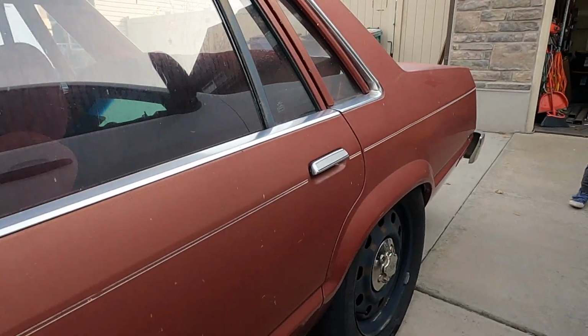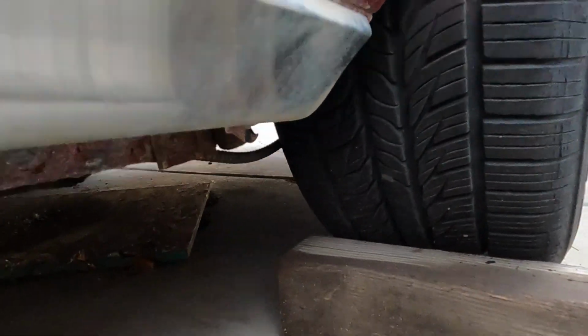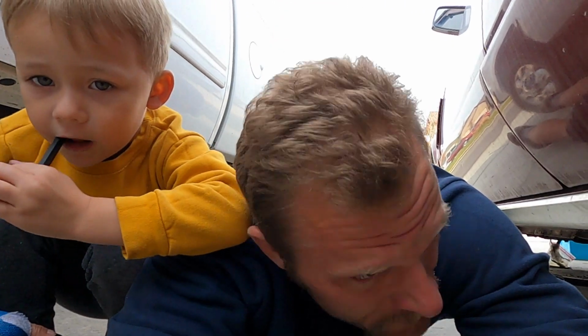So to match the rear, same thing, but it has a 2003 8.8 rear axle. So it's from a '03 Mustang. I pulled it off a junkyard. It's leaking oil, so I'm probably going to have to throw a new pinion seal in it, but it's a super durable solid axle. And then the rear suspension, I put new shocks and new control arms on it from a Mustang again. So the fact that it's a Fox body, ton of parts in junkyards, ton of modified parts, ton of remanufactured stuff. So I think it's a great platform to work off of.